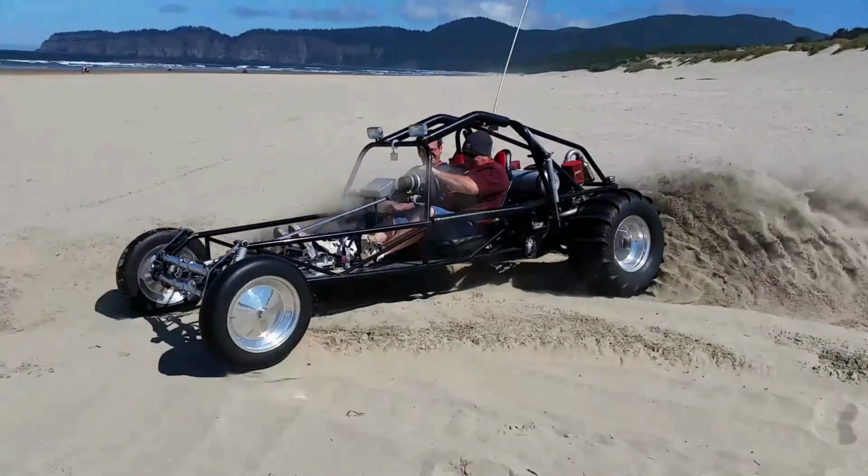One thing that I want to talk about here is that when I had taken this brake booster apart, there was rust all around the bottom of the brake booster here, and I think it was probably leaking. This runs on engine vacuum, and that's no good to have a vacuum leak there. So I think what I'm going to do is put a little RTV maybe around here a little bit, and then put that in, and then put the grommet in here and perform a test on it, see if it leaks.